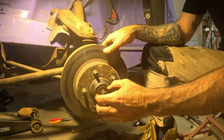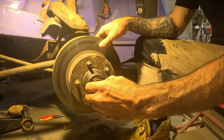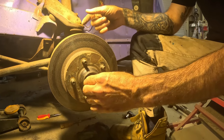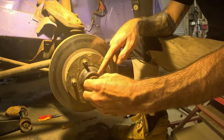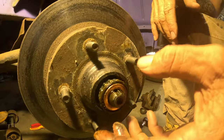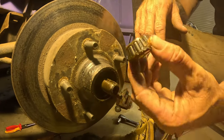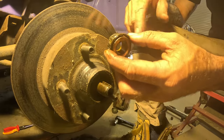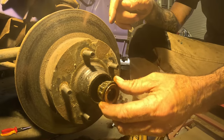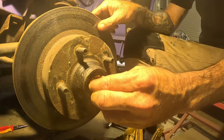With that locking nut off, we've got a little washer here with a little alignment tab — it doesn't spin, it just locks in there and keeps the bearing. These are tapered bearings. Some people might have press-fit bearings which you have to get pressed at a workshop. But most of the front ones are just tapered bearings — they push in against the taper and when you do it up, it aligns itself.